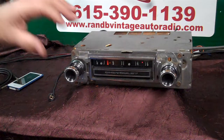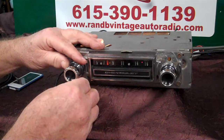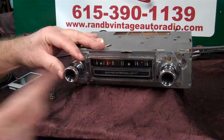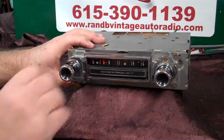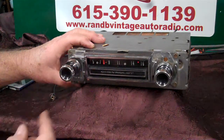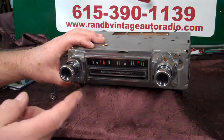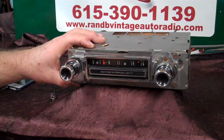I'll demonstrate how that works. Right now you're at wide open treble — there's bass, you want to go to mid. We're going to go into fader mode by going clockwise twice, like a 12 to 2 motion. It's going to beep; when it gets through beeping, we're going to be in fader mode. We can fade from front to rear. After that, we're going to go counterclockwise, like a 12 to 10 motion. It's going to beep and then go into balance mode. As long as you're moving in those modes, you can stay in there until you get what you want. When you reach where you think you like it, just stop — it'll beep once and go back to tone.